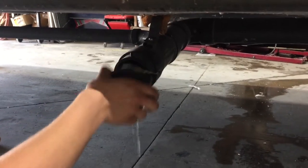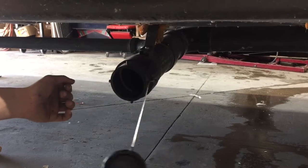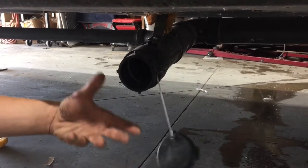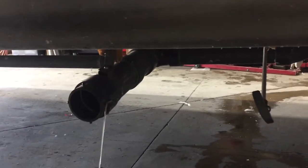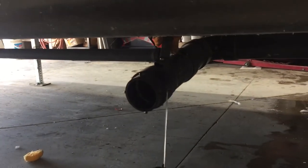Same idea — you're just going to press it in, turn it, pop it off. You're going to be taking your hose and attaching it on there. You're going to want to do your black tank first, because your black tank is filled from your toilet so it's going to be your dirtiest water. Let that drain out first, then come and do the gray, and then the other two grays afterwards, just to help keep that hose as clean as possible.